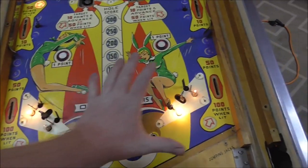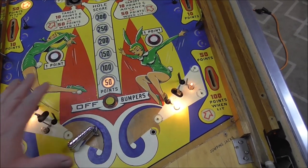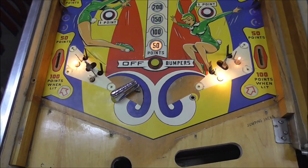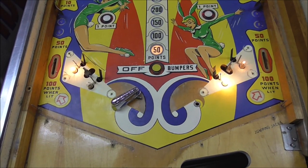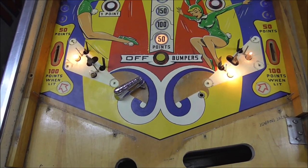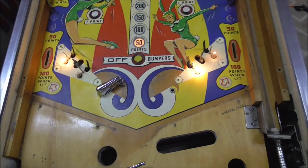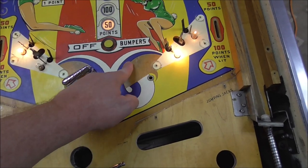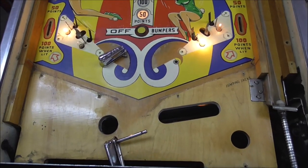So I'll just coat this area here that I painted, and I'll try to make it follow some of the lines. So maybe I'll paint up this way or something. And if you use like a satin, it kind of blends in. And then you wax it. If you don't clear it, you can't wax it. The wax will just take the paint right off. If you get the paint wet, it'll come right off. So, also, whenever you clear it, it will darken up all of this here where the varnish has worn away. So that'll darken up, and you won't see that as much anymore.